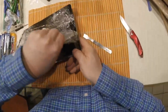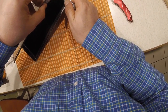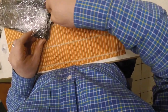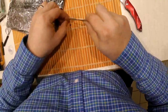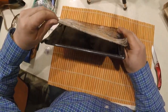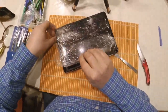Here's another mistake — I kind of rip the glass out of there, and there are ribbons to the button obviously, and there are ribbons that tie the glass digitizer to the LCD. You'll see when I get back there — you've got to be very careful. I should have been wearing gloves — that's another mistake. I'm pointing out all the mistakes so you don't make them.